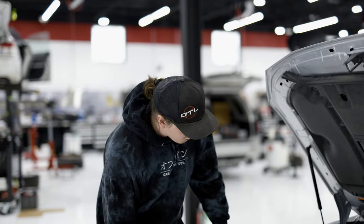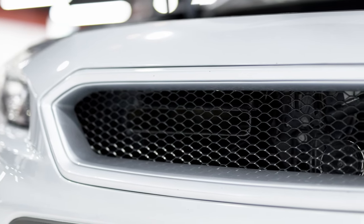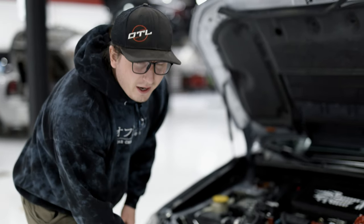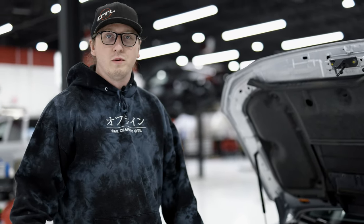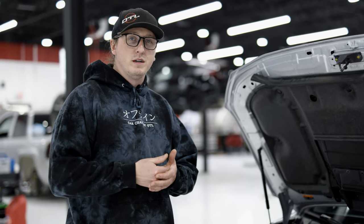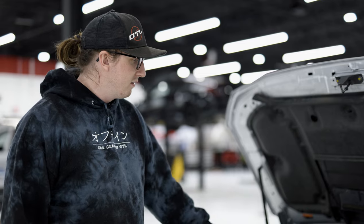So underneath the car, we have a cold air intake snorkel. And then we also have the Charge Speed inlet. You can see it's all painted black, so it's kind of stealth, but there's actually a ram air inlet. So that helps with a little bit of colder airflow as well. And obviously with top mount intercooler cars and stock airboxes, we just want to keep the heat management in check, you want to keep the heat to a minimum. So that helps us do pretty much all of that while retaining some of the stock looking stuff